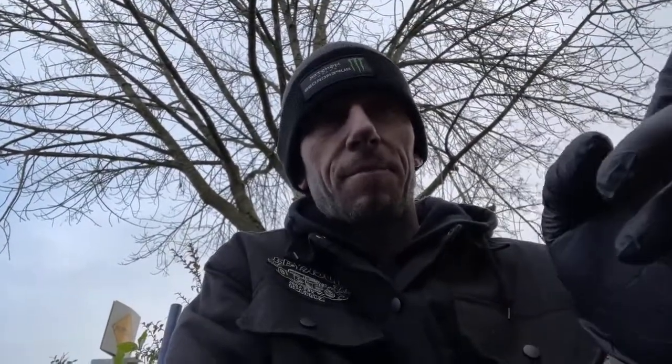I don't have time to sit down and edit videos, so here's what we're working on: a '95 Toyota Camry. I did the timing belt and the cam seal and the crankshaft seal, and it's still dumping oil out. I can identify that it's leaking down from inside the timing belt cover, and unfortunately I think it's the oil pump seal. So I'm going to have to take the belt off again.